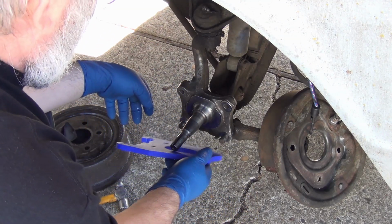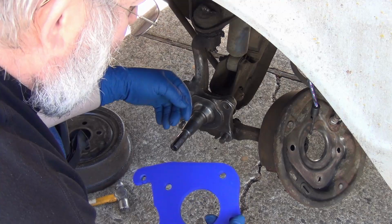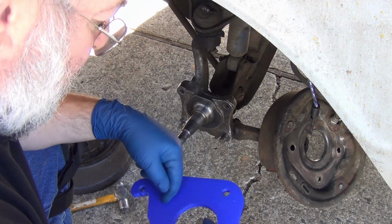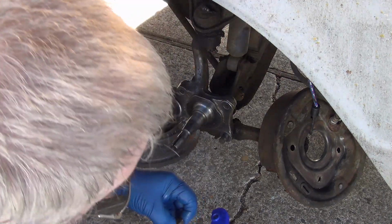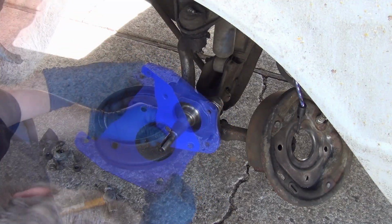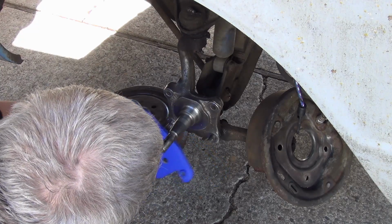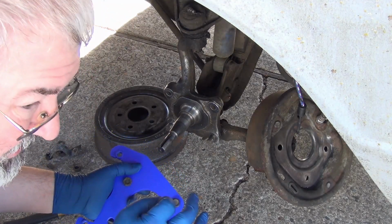So I'm redoing part of this just in case, but I did these bolt holes at .495. I'd have to measure them to see just how close they are, but those are 1/2-inch bolts, so I at least got to go open these up just a little bit. And I got to open the top ones up too. Those are 7/16. So drilled it out 1/2 inch, 7/16. They're not quite far enough apart. Okay, but let's. Yep. All right, it's big enough to go over. So for now, I think I'm going to go drill this out a tiny bit bigger.